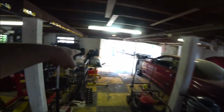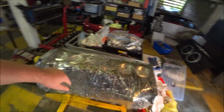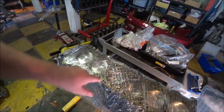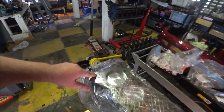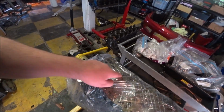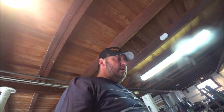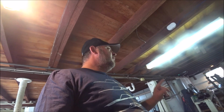Today this gets married to this. So I have an oil restrictor to block the rear oil gallery here. I've bought another dowel because I lost one, which goes in one of these, that one there. And I've got my head gasket upstairs. The head can go on.